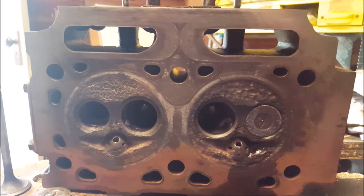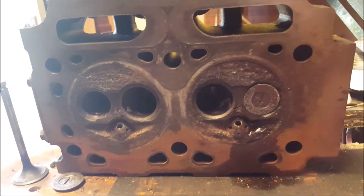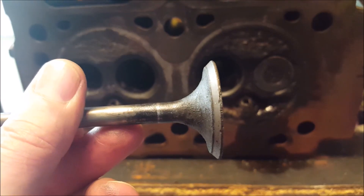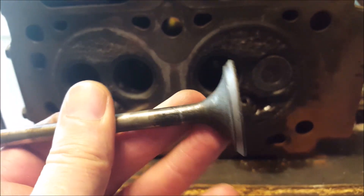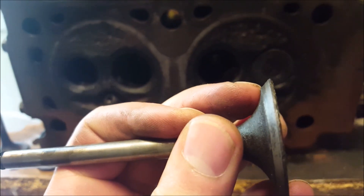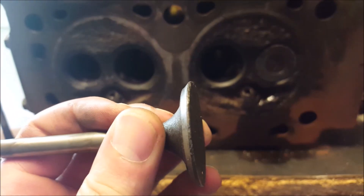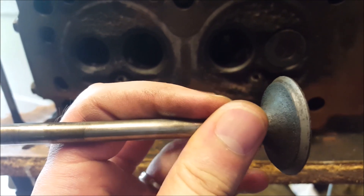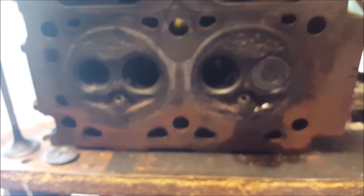I've just paused for a time of examination and reflection. These larger valves are the air intake valves, and I can tell the cutting is working because it's fresh gray all around. I can also see a little bit of a lip forming down here — see that right there, that little lip? So that part is seated in the space so low that it's not touching any of the grinding compound, which means I've cut in.